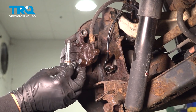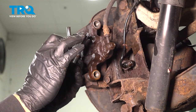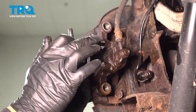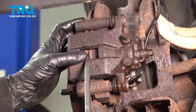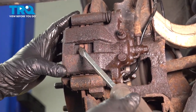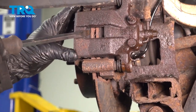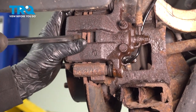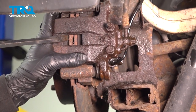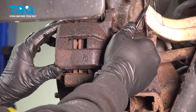When we remove our pins here, the upper pin has this little sleeve on it. I want to make sure that goes back in the top. I'm going to use a flat-headed screwdriver or a small pry bar to gently put some sideward pressure here and compress that piston just a little bit on our caliper. This is going to allow us to slide this off.